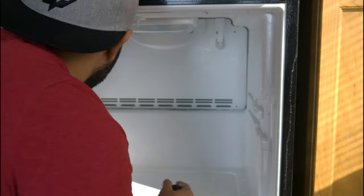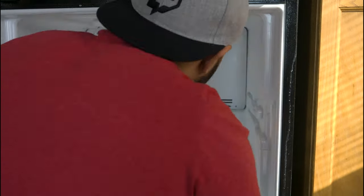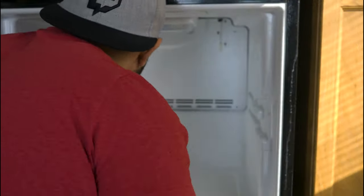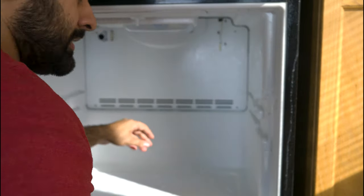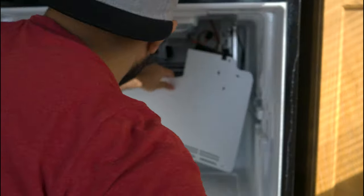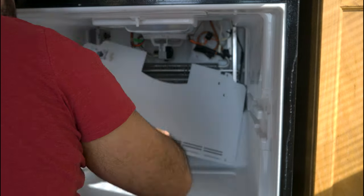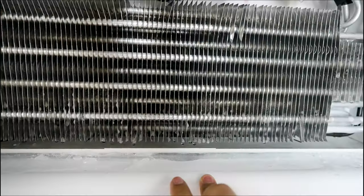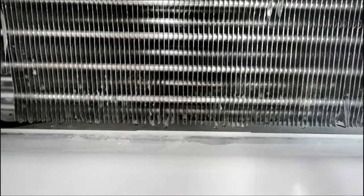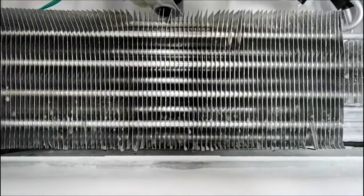On the cover at the back of my freezer there was a diagram showing exactly what to do with your screwdriver to undo the cover for the sensors and plugs. The back of your freezer is just a thin layer of plastic — if you can't reach, push in the sides to crack the ice there and fold it so your hands can get around the edges. The dark spot in the ice is the freezer's drain. There's a big sheet of ice covering it just under the radiator, and the radiator itself has water dripping from it — that's how the sheet of ice was made.